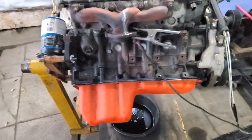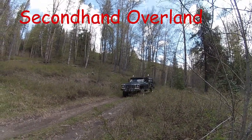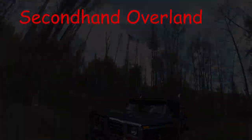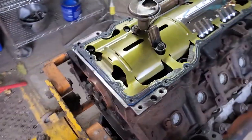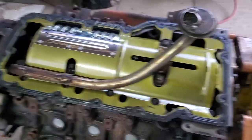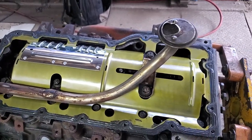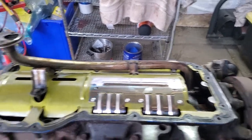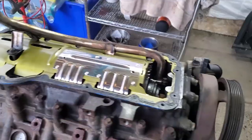Welcome to Secondhand Overland. I'm just about to get the oil pan back on. Got the new gasket back into it, all the main bearings are checked, connecting rod new bearings all installed, everything's torqued up. New seal for the oil pickup and we'll slam this pan back on and good to go.